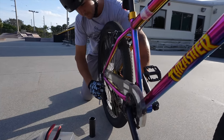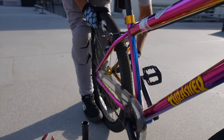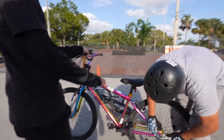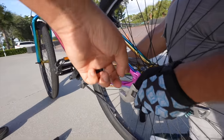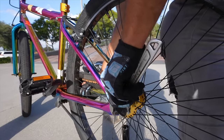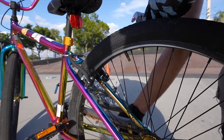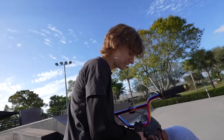First things first, we're trying to get this back wheel in a good spot so the chain doesn't fall off. Your wheel's a little bit too far forward - that's why the chain keeps falling off. These back here are called dropouts. You can slide the wheel forward to take the chain off, or slide it back to make the chain tighter. Matt's snugging it into a good spot so there's going to be tension on the chain and it won't pop off. So now the chain is snug for the first time ever. The chain can finally rest.